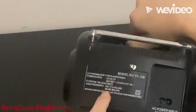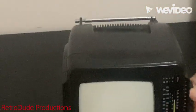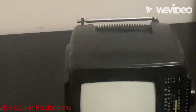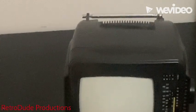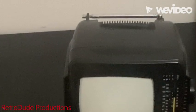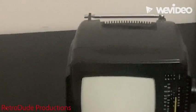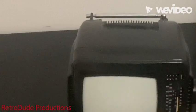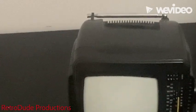The AC transformer that's built in buzzes and sometimes flickers. It also has a very cheap tuning system with dials for FM, AM, VHF low, VHF high, and of course UHF. UHF only goes to channel 69 on the dial, but actually the dial lies — it goes way above 69 in UHF channels. Also, the FM tuner isn't accurate because they used the FM method as it was used back in the USA and maybe Japan. It only has a speaker on the left, and those vents on the front are fake. It has an extendable aerial.